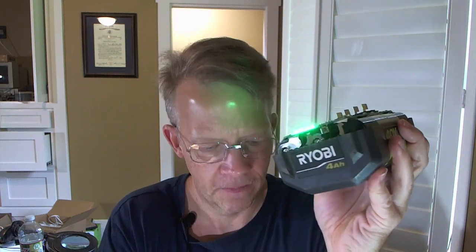Once you jump those pads, the four lights on the end will all come on or flash after a few seconds. At that point you can test it by pushing the button. In my case this battery is now showing fully charged after taking it out of safety mode. After the reset, it probably won't blink four lights anymore — it'll just show a normal charge level, like one bar, indicating the battery was discharged.